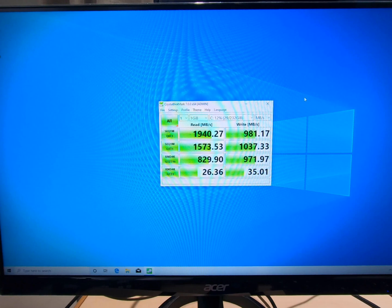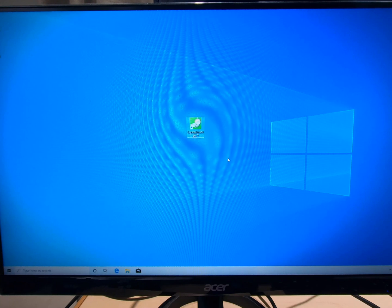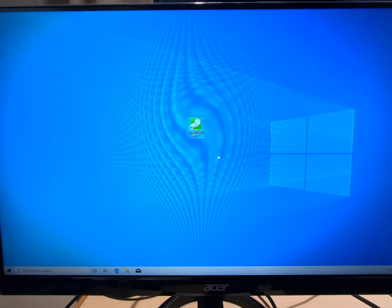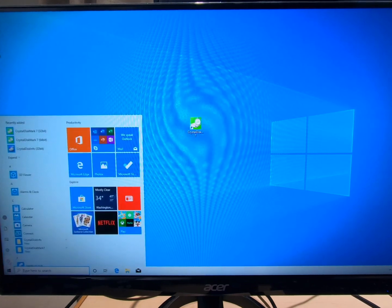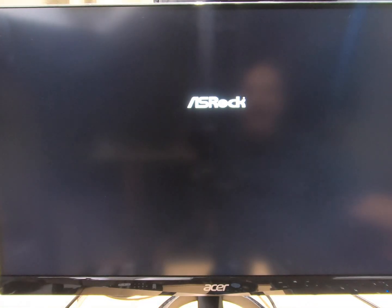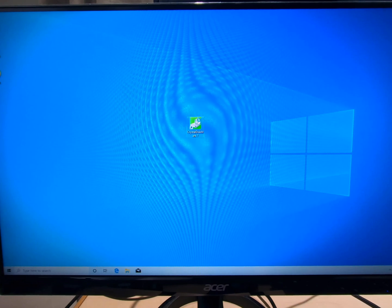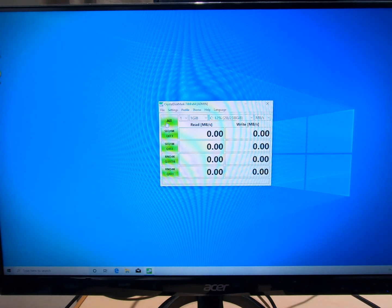Here are the results on our M.2 that's on the motherboard — pretty amazing. We have one final test: that is the daughterboard I bought off Amazon. This plugs into the PCIe slot, and it has an NVMe drive on it. Let's go ahead and get that started. Power down, restart, F11 — booting from the PCIe NVMe. That feels just as fast as the onboard M.2, but let's see the performance numbers.